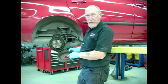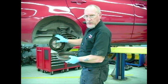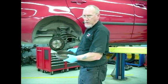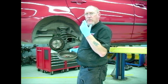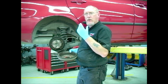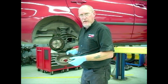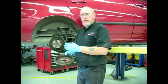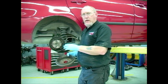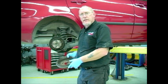There's going to be dust and debris inside the drum and all over the brake components and shoes on the backing plate. This is something you really don't want to breathe in big lungfuls of, so wear some type of breathing protection to avoid inhaling the dust and debris. When you wash it down, use a brake washer — don't use shop air to blow it clean. Then you can go ahead and continue with your inspection of the brake system.